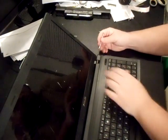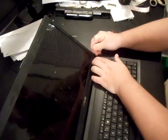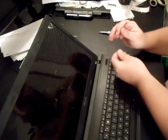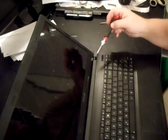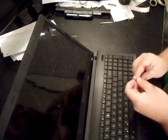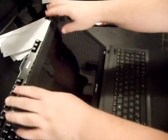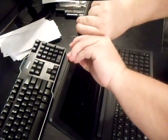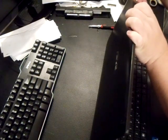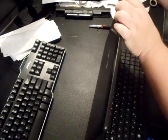If you had four screws, you would do the same thing to the two top ones. Next, take the screws out — one, two. Then you just pop off the bezel. Use your small flat head, and if you have a credit card or something, that'll help you as well to get between those edges. You want to be very careful that you don't crack the bezel — just use common sense. As you can see, it's pulling apart and you might have to sometimes lift up on it.